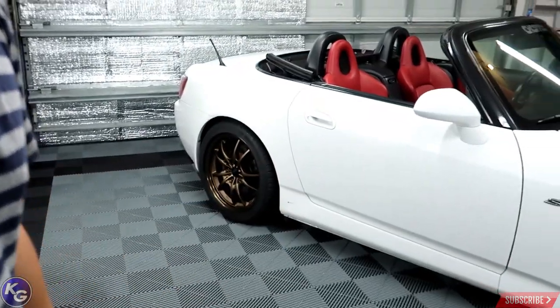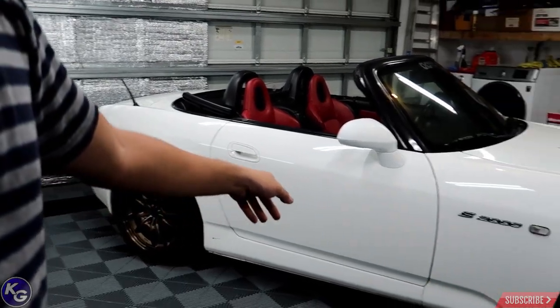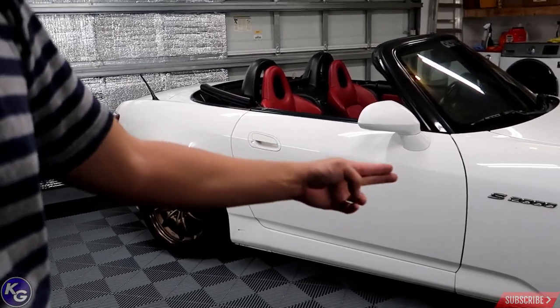It's been a very tiring night but I finally got the car done. I put the rears in — it was equally as easy as the front. When you go into the little gas area where the struts sit, you can use extensions and magnetic tools to hold the bolt so you don't lose it, or just take the filler neck out. I left it alone and dealt with it the hard way. The rear is lowered nicely and the front is very close to stock — about a two-finger gap all around.